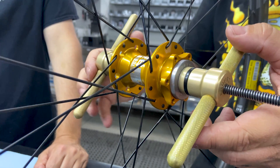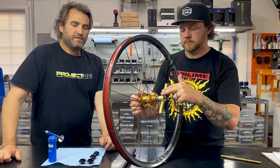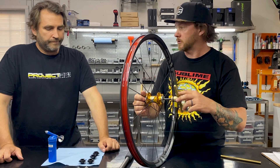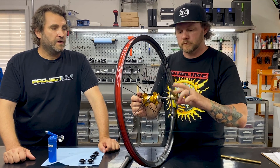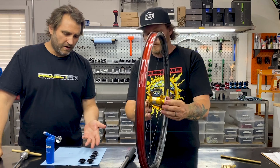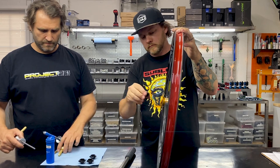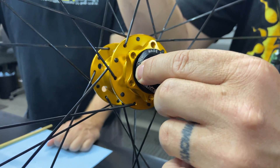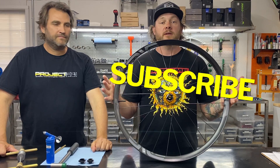Just squeeze it with medium pressure — that's it. These may not have even moved; it's just good practice to press these in and make sure they're seated properly before we put the new end caps in. If they had moved at all, you'd feel a little play once you mounted it on your fork. Now we're going to take our 15 millimeter end caps and just pop them right in. That's it — ready to be mounted, go ride.